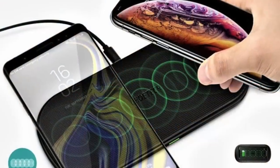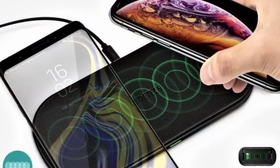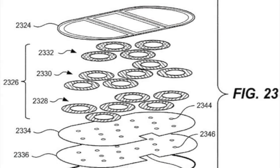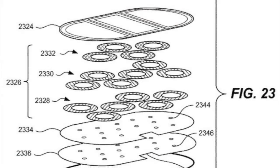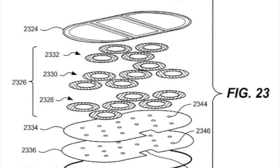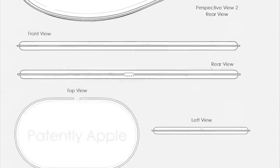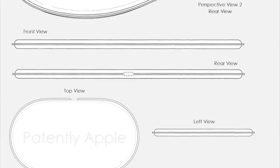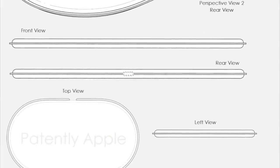As I mentioned, there were Apple engineers who didn't think AirPower's design was thermally possible from the beginning, because of its multi-coil design. Up until that point, there was no charging mat on the market that had more than five coils. But according to several rumors, Apple was planning on including anywhere from 21 to 24 coils in AirPower, resulting in a heat management nightmare. And because Apple wanted AirPower to be one of the thinnest mats available, there was virtually no way to engineer efficient heat dissipation.